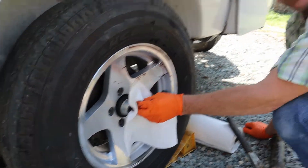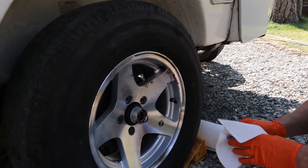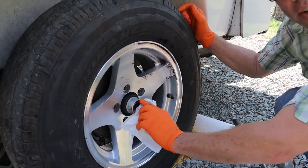It's best to spin the wheel while you're doing it, so that the grease gets worked into the full diameter of the bearings and you get most of the old stuff out. Dirty job, but somebody's got to do it.